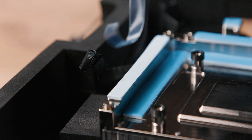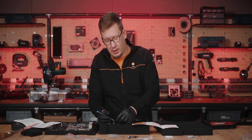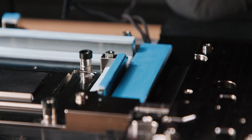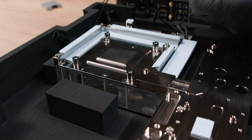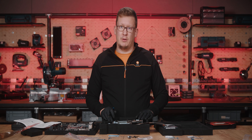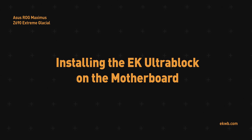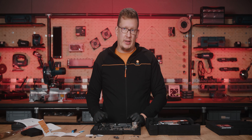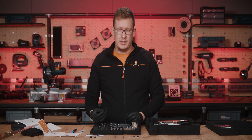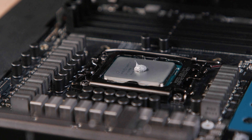The next step is removing the protective foil from the other side of the thermal pad — this is where I use a sharp tool because I'm wearing gloves. Check that your pads are now bright blue; make sure that you have removed all of the protective foil, which is dark blue. Now we can apply the thermal grease. Try not to apply too much — my best recommendation is a pea-sized dot on the center of the CPU.